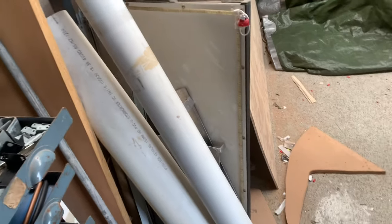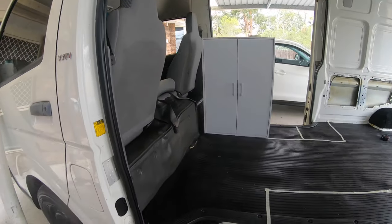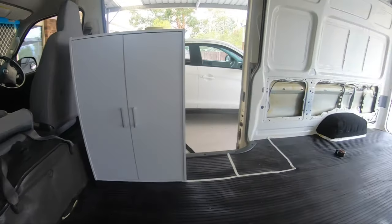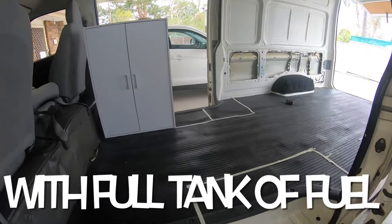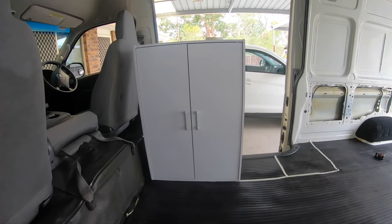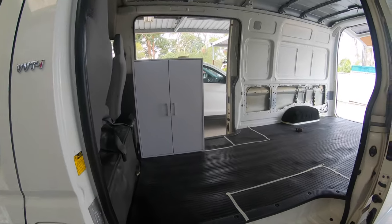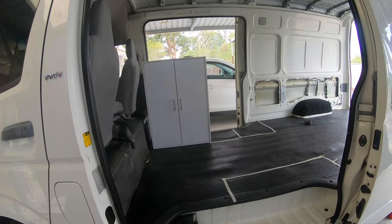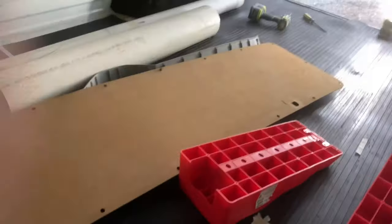I'm not too sure how much detail to go into — I might just do step by step as I do things on the van. I went up to the weigh bridge and it came in at 1920 kilos. This van has a GVM of 3200. I'm going to weigh everything before I put it in. Watch out — if you do this sort of stuff, check your GVM. Be very careful you're not going to end up too heavy, or you won't be able to finish the build.